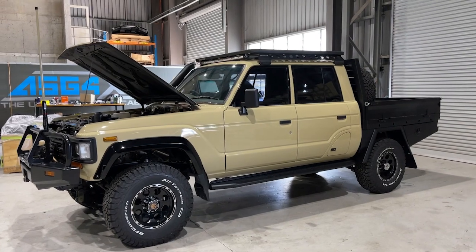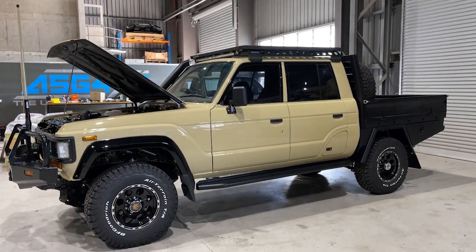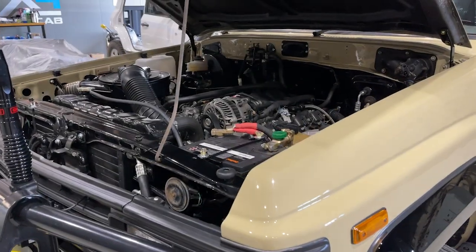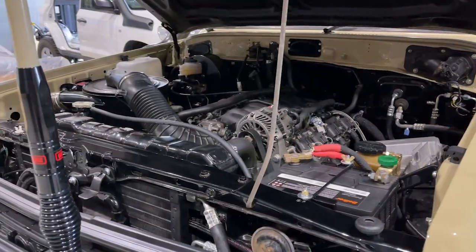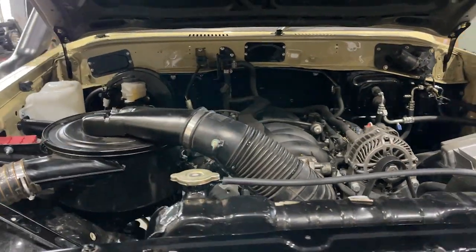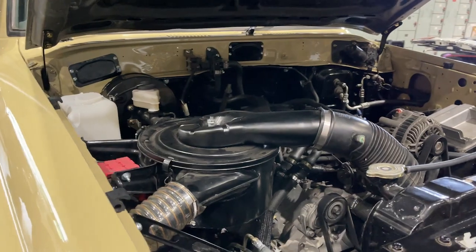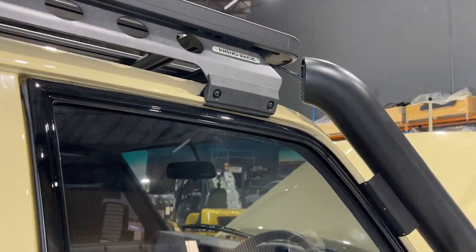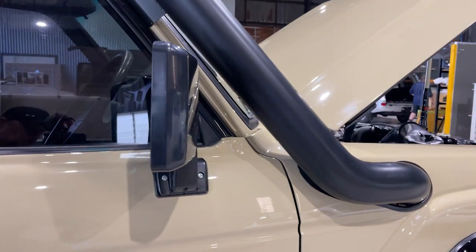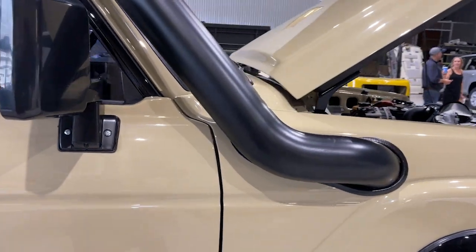Have a look at the ST60 by ASG. This is a 400 horsepower car — it's got the LS1 in there. They've got rid of the standard engine and dropped in the LS1. It's just got the 4L60E gearbox, and to mate it all up they're using one of Mark's adapters. Five-inch snorkels are on this just to help it breathe — the standard snorkels just wouldn't let enough air flow, so they've gone to the five-inch snorkel.